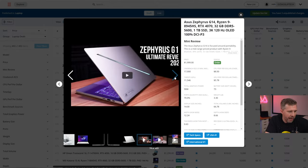So if you run into that problem where the application is opening with the wrong GPU, that's when you go to your Windows graphics settings. I just type in GRA in the Windows search button, and here we can select applications and change which GPU is being used to launch that application. If Windows is confused about which application, this did happen with the Omen 14, I had to add a couple applications into that graphics launcher. I'm just mentioning that because it's kind of disappointing that I had to mess with that.